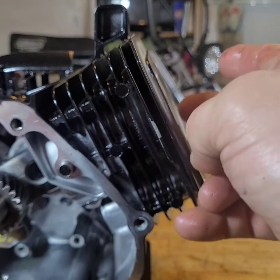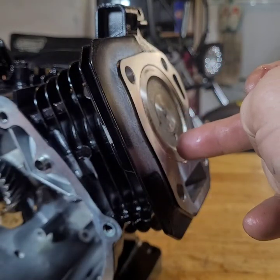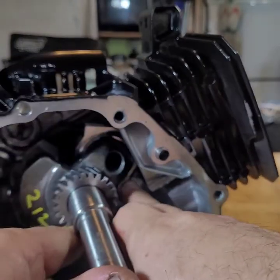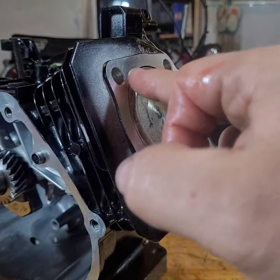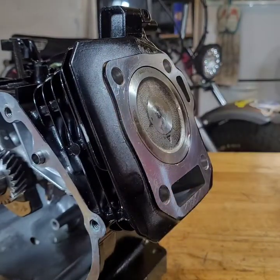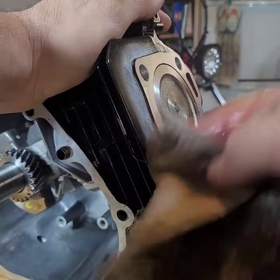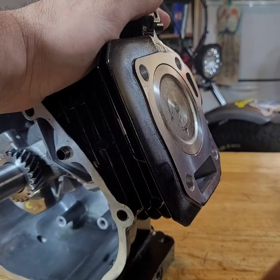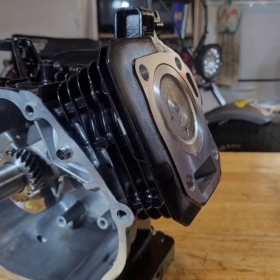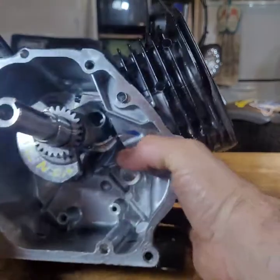I believe from the factory, the piston is about 20 thousandths down in the cylinder. By getting this rod, the 20 thousandths longer ARC rod, you're putting the piston right at zero deck, which increases compression, which increases horsepower. That's what everybody wants. Now, if I had the budget to put a flat top in here, I would have. But the budget only allowed a rod and a flywheel.